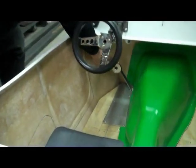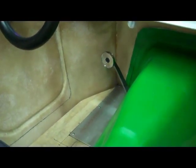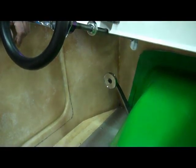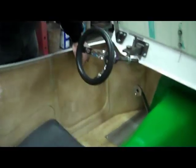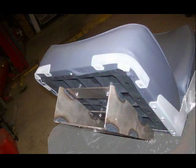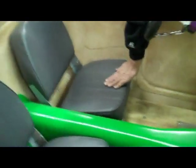You get a brake pedal and pad in the car, and that's placed in a position where it's going to be proper for the accelerator pedal, which will be next to it. Even though you don't see it, there's a brand new master cylinder underneath the floor, and again properly sized to our front and rear brake application. You get 2 foldable seats for the car. You get metal seat risers to put them in the car. And something that we do in our car that other people may not do properly, at least I think they don't do properly because I've sat in a lot of T-buckets: our ergonomic seat angle and back angle is the same thing you get in the car that you're driving today.